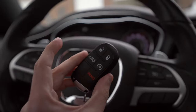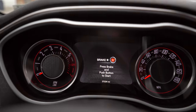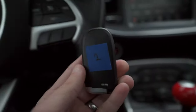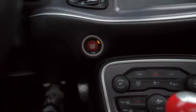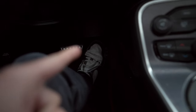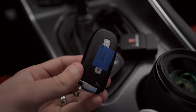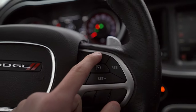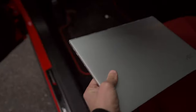Let's do this one more time from the inside. Shut off the car and lock it with key fob number one. The hazards flash and then flash again showing that the feature went off. Now I take key fob number two and unlock the vehicle with it — notice it did not flash again. The vehicle is unlocked but with kill by fob my pedal is disabled and the pin is still counting down because it wasn't unlocked with our first key. The gas pedal won't work until I put the pin in and enter it correctly. Now I'll plug in this laptop to show you exactly what's going on with this feature in our terminal.